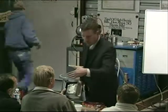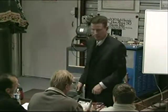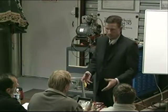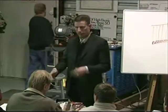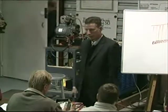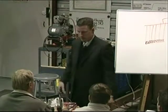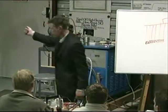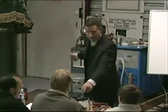But on these units, once that last piece is welded in, you cannot take them apart and clean them. That's why you have to fill with water, shake, dump it, fill with water, shake, dump it, and then add a little vinegar to break it loose, and then a couple more times. So these current units are not serviceable. The newer ones, which are under here, I'm not sure if they're going to be serviceable or not, but you'll at least be able to get access to the plates.